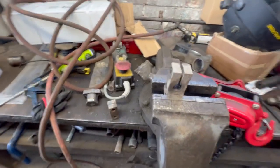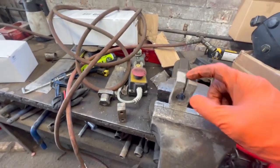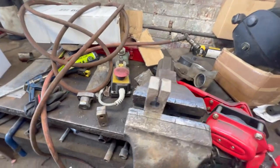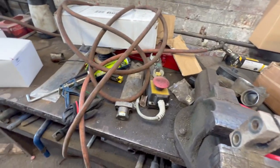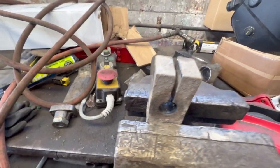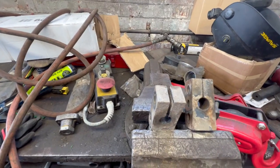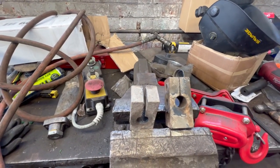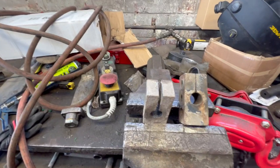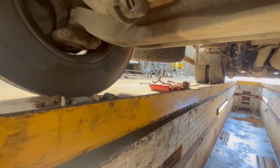On the front of this spring there are two pins that sit in here. That's one that I've just had my chisel on - basically chisel up from the bottom, open it out, then the front top. That's the other one I've not done yet. You can see the difference - look how close that one is together compared to that one. When you put your bolts into the chassis it'll tighten that up onto the pin on the spring.